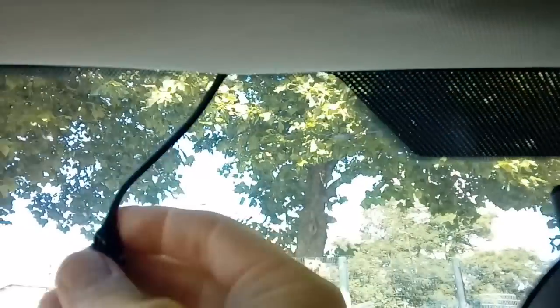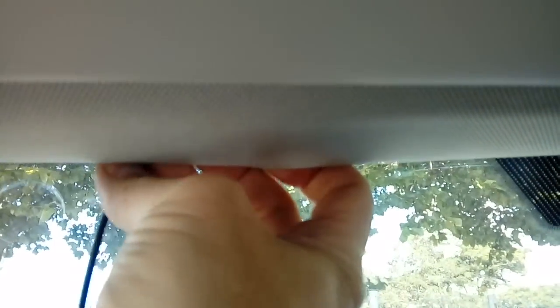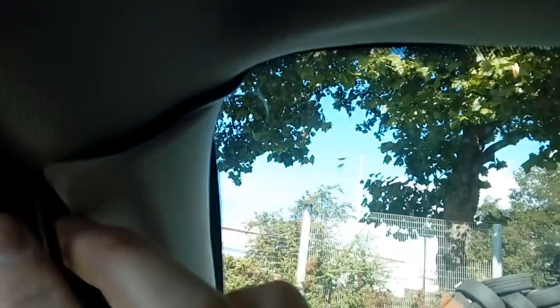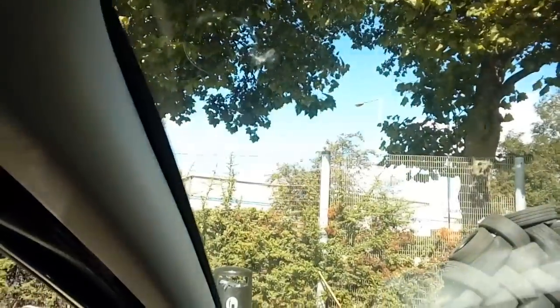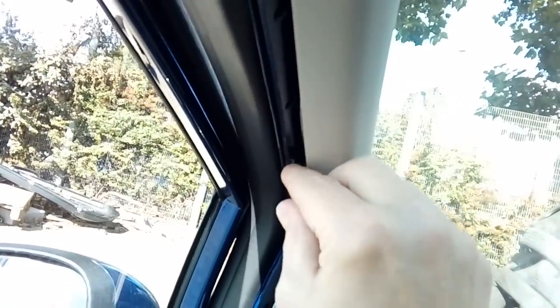You're basically going to want to put your wiring in the headlining. Don't go at it like a bull in a china shop — it is only a headlining and you don't want to damage it. Carefully pull the headlining down a little bit with your fingers; make sure your hands are clean because if you've got beige headlining it's going to end up absolutely filthy. Tuck the cable in along the headlining to the corner. At the corner you're going to have to put your plastic pillar forwards a little bit and hook your cable behind it — this is where you want your plastic tool again so you can shove your cable down snugly behind there. Follow on down the pillar, hiding the cable, and put your rubber seal back on so it holds it in place.